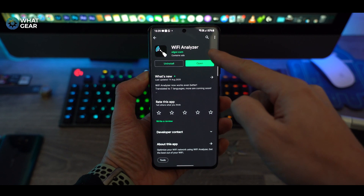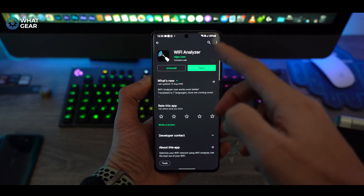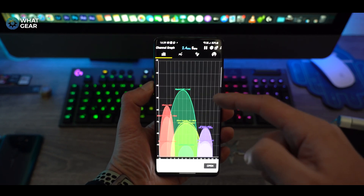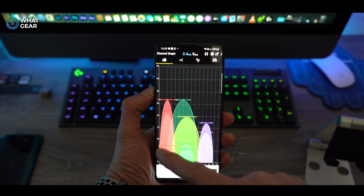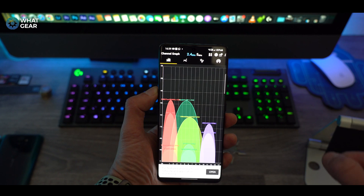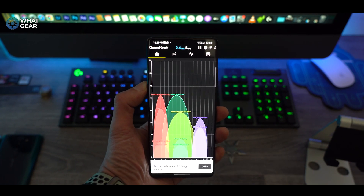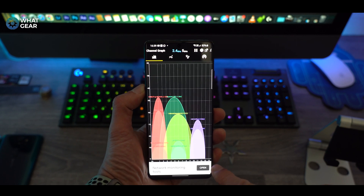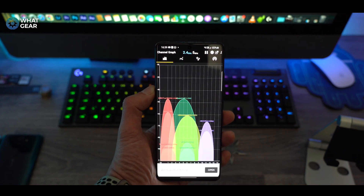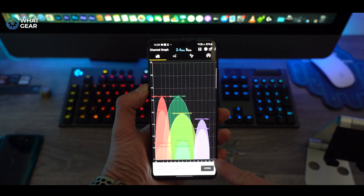This app is going to help you — it's called the Wi-Fi Analyzer. Download it on your phone via the Google Play Store or the App Store. Open the app and it will show you a graph of Wi-Fi frequencies being broadcasted through your property. We can see the signal strengths of those Wi-Fi connections represented by the height, and the channels being used across the bottom of the graph. We want to pay close attention to the channels that have no overlaps — ideally you want to find a channel that's not being used at all. Once you've found one, write that down on a piece of paper.